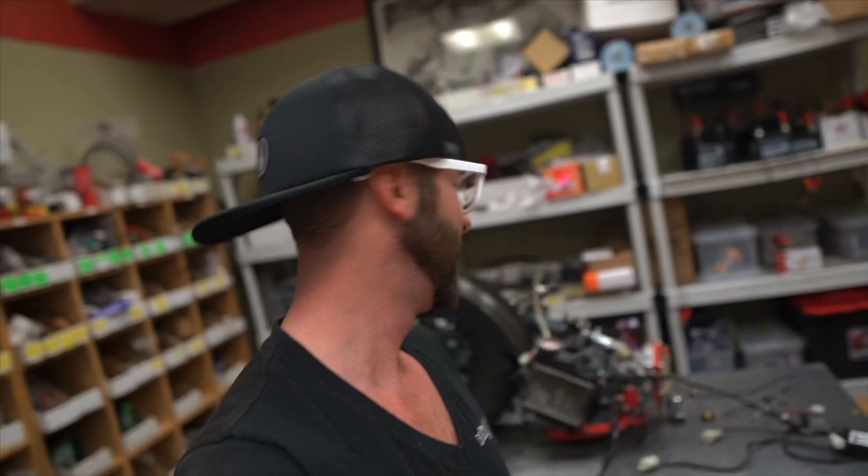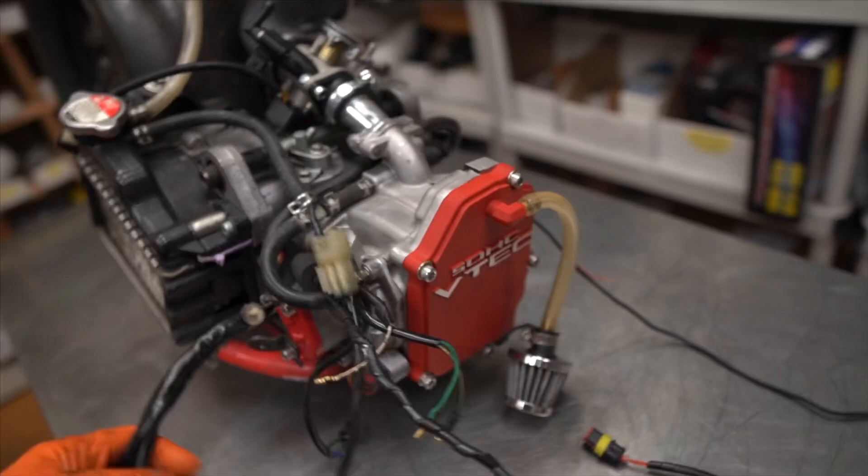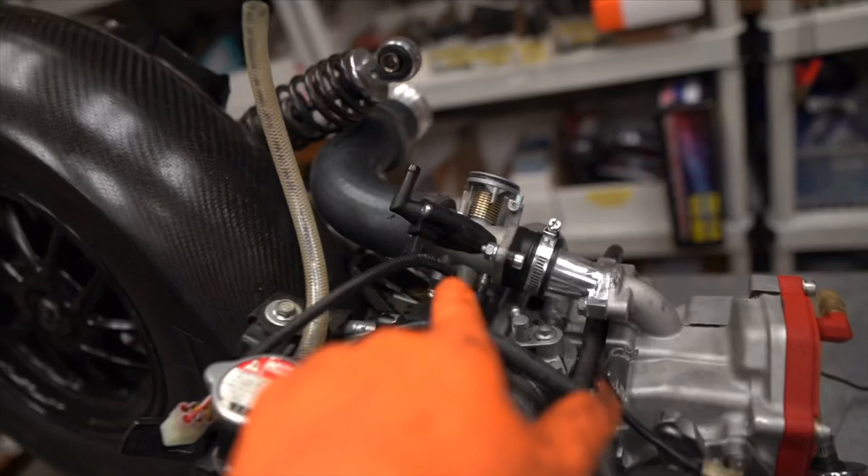Alright, it's out. Couldn't get the EFI off because this bolt is just - there's so many random things on here that I need to fix. The Ruckus motor, unlike all the others, you can unbolt the motor from the CVT, so I'm going to do that, get this wheel off, so all I'm dealing with is the motor right now.